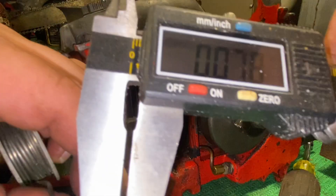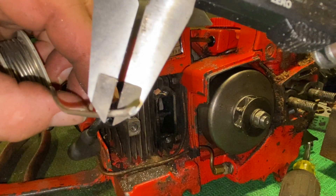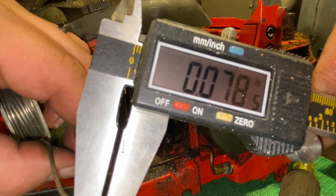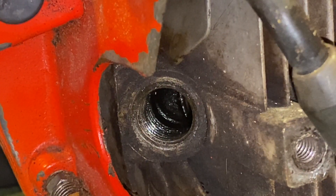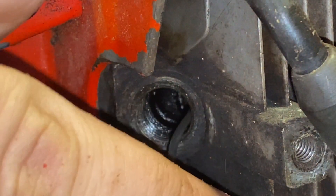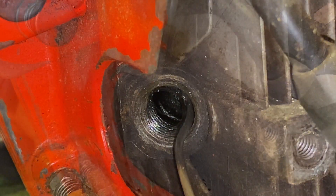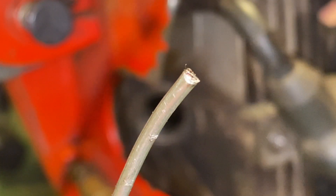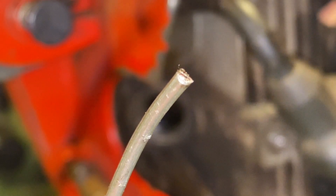Now this particular solder — I like to measure it beforehand. As you see, it comes up at .078, which is commonly referred to as 78 thousandths. In order to do this test, we simply stick it in the spark plug hole and push it over to the edge of the cylinder. You can feel it make contact — just push it over until it makes slight contact to the edge of the cylinder. At this time you just pull on the cord one time. And now, as you look here, the piston as it traveled up and down never made contact with my solder, which means my squish is more than 78 thousandths.